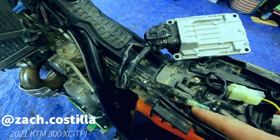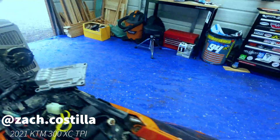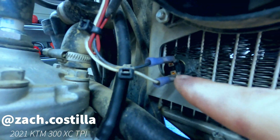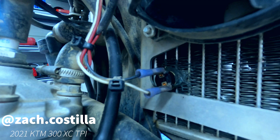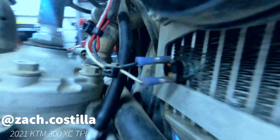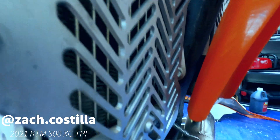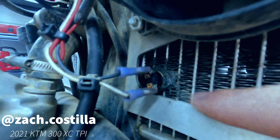From here with these wires, I brought the wires up, followed the loom until here, and then brought the wires down under this harness. Once I came in here, I bought this thermocoupler switch right here — I'll post a link for you guys to find that, same with the harness and the fan. This little coupler has a metal or brass rod that goes through the fins on your radiator. I had to cut it short, but it still works just fine. I took some JB Weld and stuck it around the corners here just to keep it in place so it wouldn't come out.